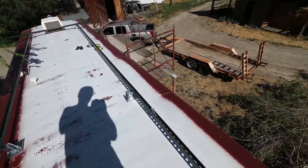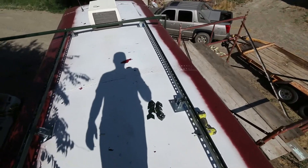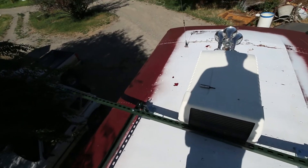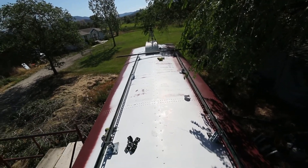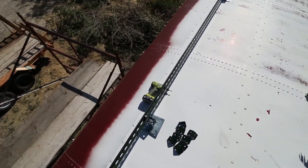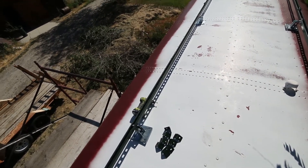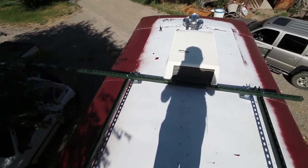My next step is to actually drill holes in the roof, then I'll take butyl tape on the bottom of each of these, tape it all up really good, bolt it down, and once it's bolted down and everything's secure, I'm going to come back through and put Dicor over everything. Once that's done, I'm going to be drilling a hole through the roof and running the electrical down — I've got a weatherproof box for that. I'll quit talking and start working and show you guys what I get going.